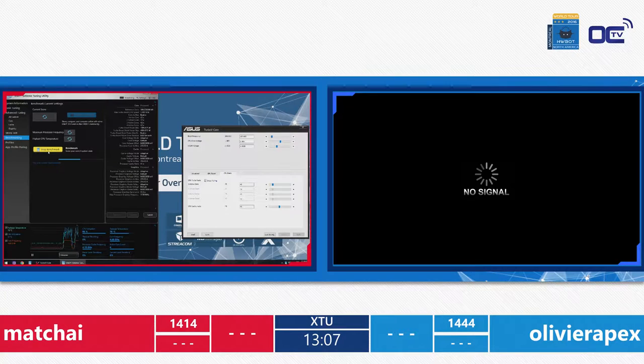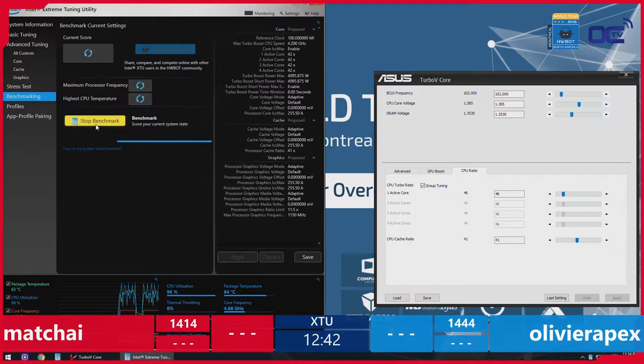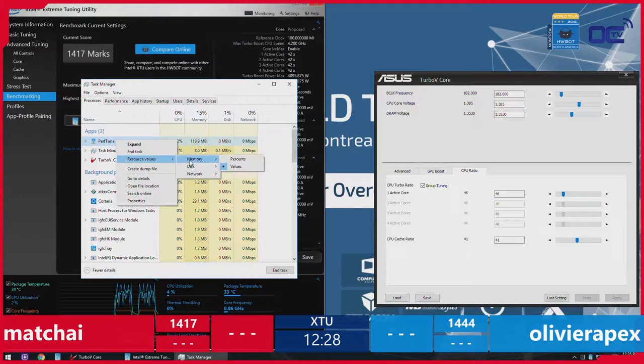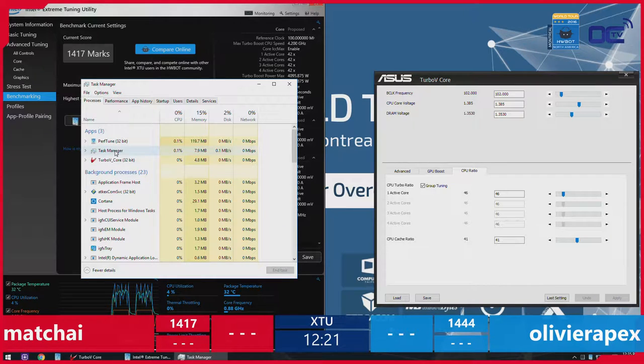So we had a question on the Twitch channel from PooFan42. He probably likes yellow cuddly bears, judging by the nickname, and he's also going for his first steps into overclocking. So PooFan, what you're seeing now is the Intel Extreme Tuning Utility I talked to you about on the Twitch channel. It's a stress testing tool for your setup, and you can easily detect how it's running. If it crashes, it probably needs a little bit more vCore, but the interesting part for daily overclocks is that you can read out the temperatures as well. Plus you can see if the system throttles. Throttling means it goes into a sort of safe mode and downclocks your overclock again, so the setup will not be damaged. It's a safeguard for your CPU and all the other overclocked components in your PC.